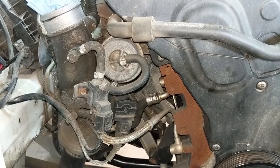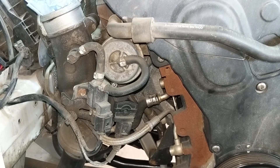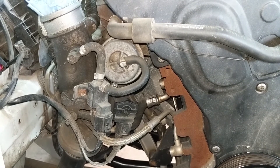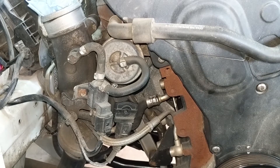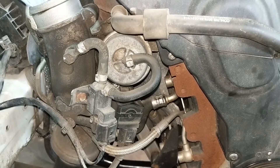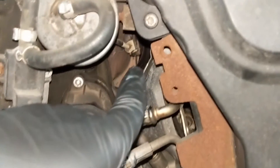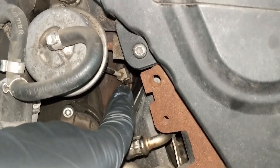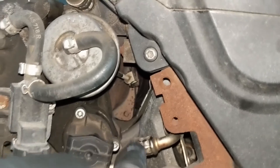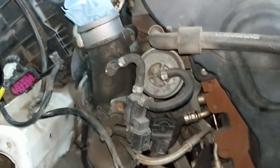If you're watching this video looking for an exact diagnosis of when to determine if an N75 valve has gone bad beyond just the results from bench testing, I recommend just replacing the valve as a matter of good maintenance. Problems with building and holding boost can be associated with other components in this ecosystem as well — you could have a failing wastegate actuator, the rod behind it might not be aligned correctly, the wastegate valve in the turbo housing might not be working, the diverter valve might not be working, or you might just have a good old-fashioned boost leak.